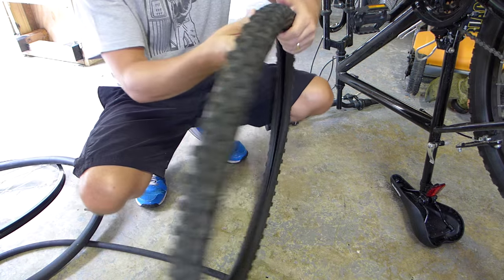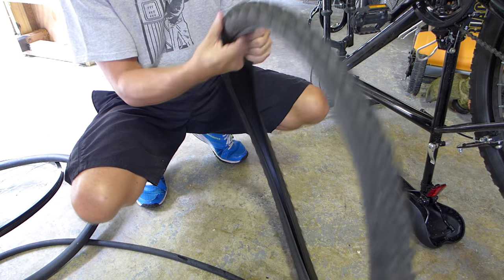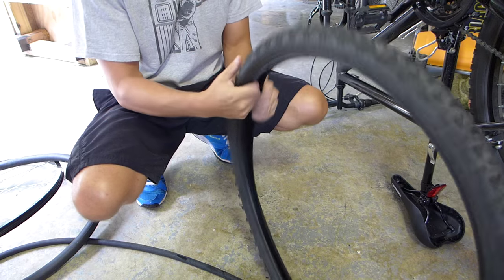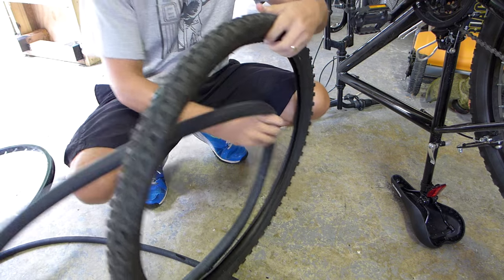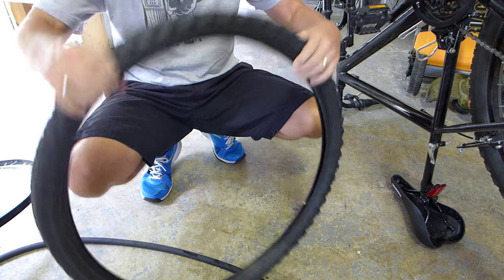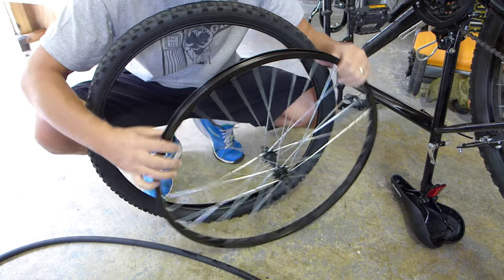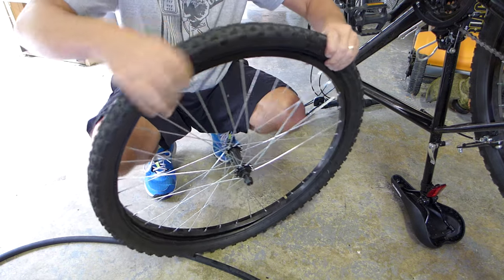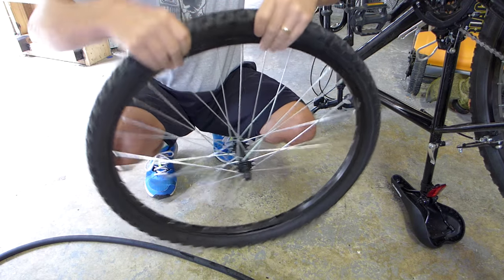Patched and ready to go again. We're going to take our fingers and make sure there's not anything still in the tire, because you don't want to put your tube back in and have something still stuck in there — it's just going to puncture the tube again. Once you're confident there's nothing in the tire, put your tube in. Then get your rim, find the hole for your valve stem, put your valve stem through the hole, roll it around, putting the tire and tube on the rim — just squeeze, push it, pull it over.